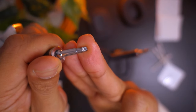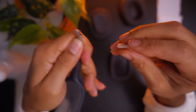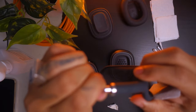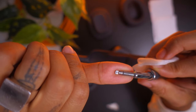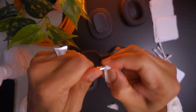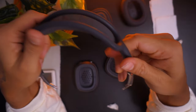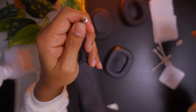This should solve all your issues. If you look at that contact, it has black gunk on the little copper metal piece — that's what we need to clean off. Make sure it has a clean connection. This is the easy part, really. The hard part is putting it back together. You want to be thorough because you don't want to do this twice — the first time I did this I did a half-assed job and had to take it apart again. If you're worried about which side is left and which is right, it doesn't matter — it's reversible. Apple was smart about that.